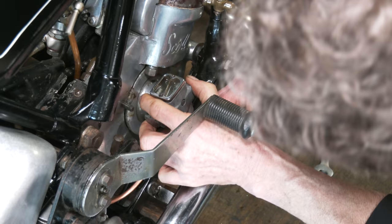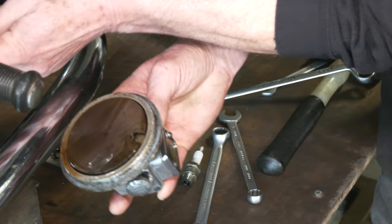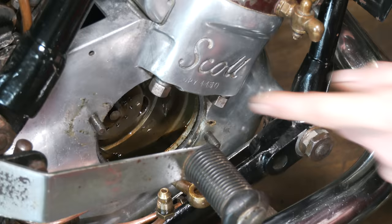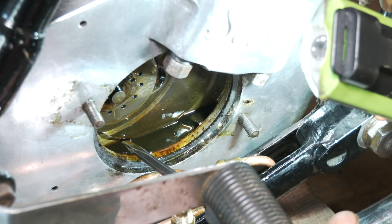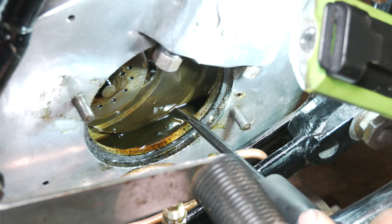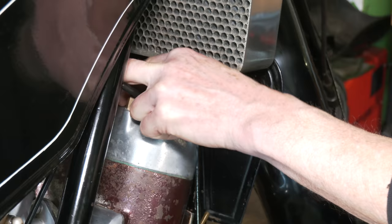Just going to show you how the pump works. The drive is taken from the crank assembly — we've got a cutaway here that has to engage. If you look up inside here, we've got a peg that engages with the slot, and it rotates it. In here we can see we've got an oil level. I've been told that this collects here — there's probably a surplus amount of oil here, and it's taken through the bearing at a particular time on the cycle. So what we'll do is take both plugs out and turn this engine over in gear and see what's happening.